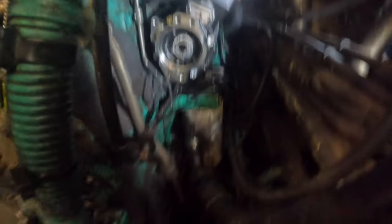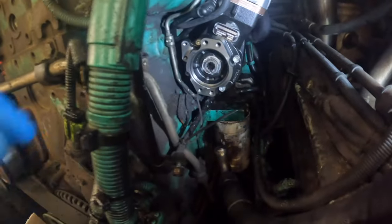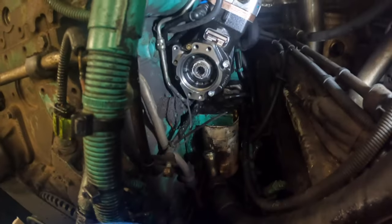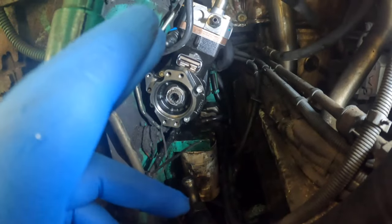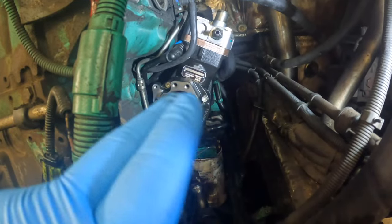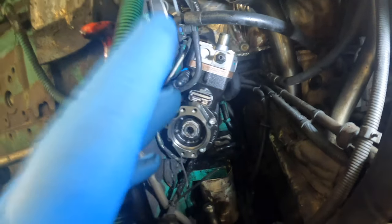Just a little tip: because this is in a position where you have to have the gear in line with the flywheel, if you come down here on the crank and turn it — which will turn the crankshaft and then turn the flywheel inside — you can get lined up and push it in. So it's bolted up, all nuts in and everything. It's now about getting all the pipes on, getting the tandem pump and power steering pump back in and all the pipes back in on top. The hardest bit is done now — it's all plug and play.